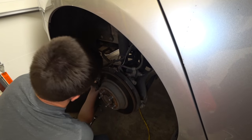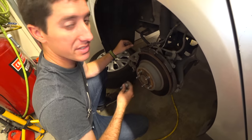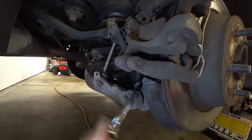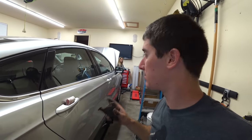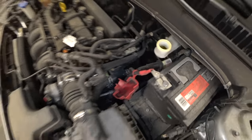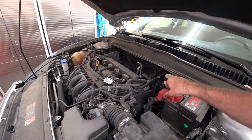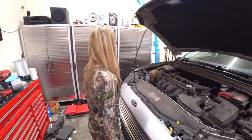We can throw the wheels back on and you're good to go. Two more bolts, put a wheel on, this thing's wrapped up. Shout out to Ford for the limited wrench swing on that bottom bolt — the top bolt was super easy, the bottom bolt not so fun. Your brake job is done. We're going to go ahead and take the parking brake out of parking brake service mode. As a bonus, your brake fluid actually looks like brand new. It's right at the top so we are going to leave that alone and put the battery cover back on. We are done under here.